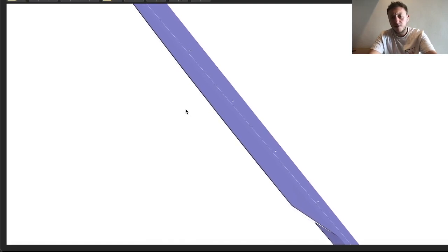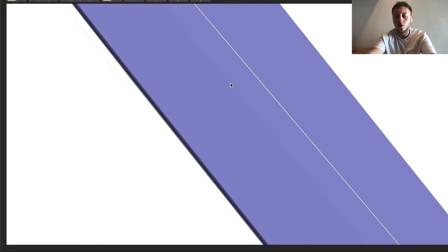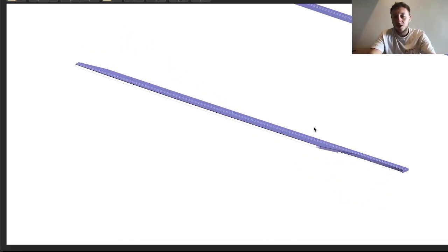We look at the fixings. Again, self-tapping holes, pre-supplied in the box. You'll get 4.8mm self-tapping screws made out of stainless steel, and a nice tape line all the way along the side skirt to get a nice bond between the side skirt and the body line, so you don't get any dirt and debris stuck between here. So again, as you'd expect, MHC have really thought about everything here. And yeah, that is the side skirt.